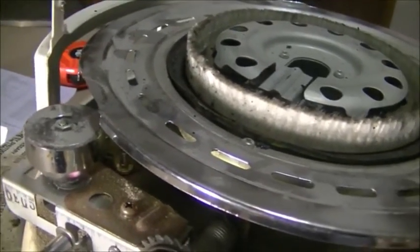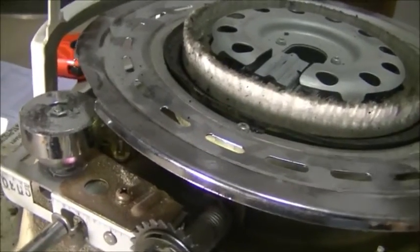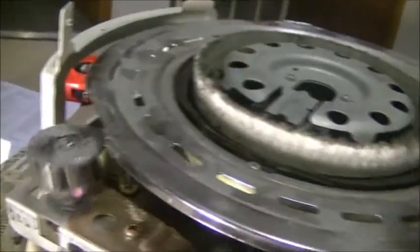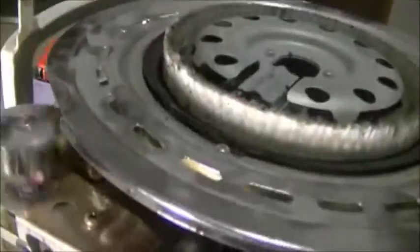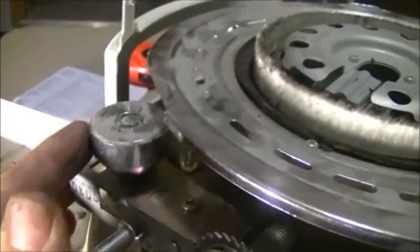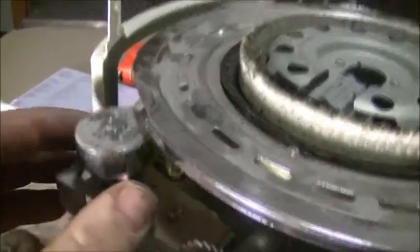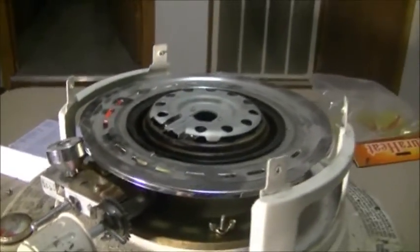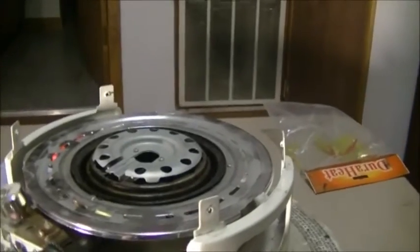Here's what that floppy thing is for — it's a safety feature that will drop the wick down so you don't start a fire if you tip it over. I'm going to hit this just like it would if you were tipping it over. See, the wick dropped right down, and that will put the flame out. So that's a neat little safety feature.